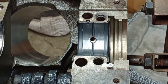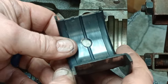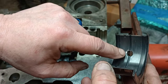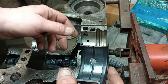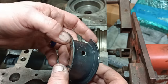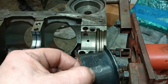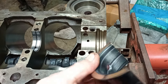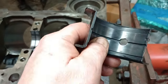You can either grind the bearing out, or file it out, or you can actually grind the block to fix that problem — it is perfectly okay to do that. After you do that, you want to make sure you chamfer this and make sure there are no burrs on the edge. You can do the bearing or grind the block, one or the other. When you're done, there are going to be burrs, so make sure you take a round file and file that edge off — get all that off, same thing on the other side.